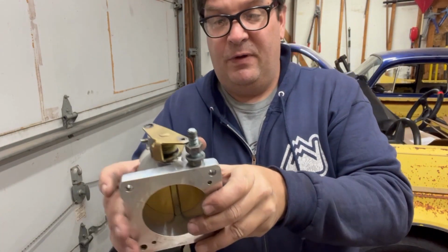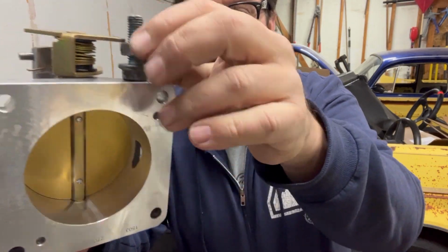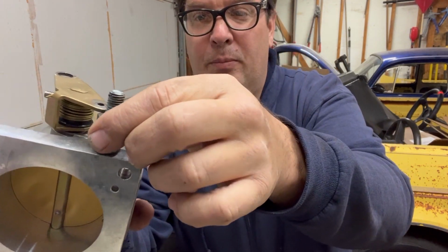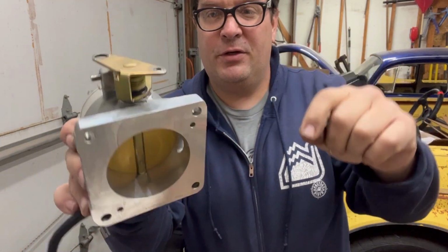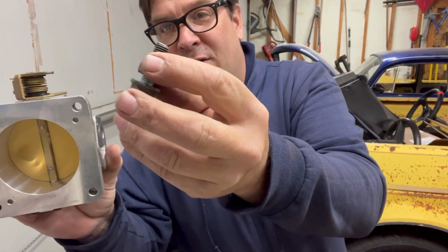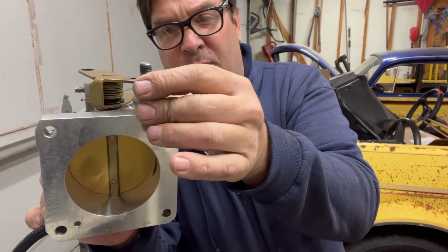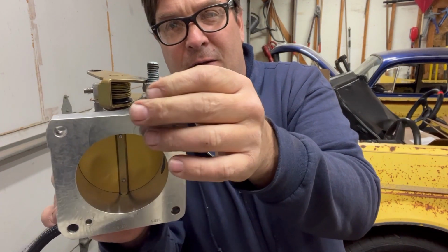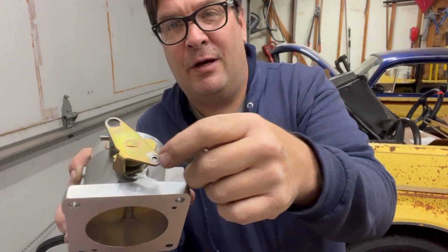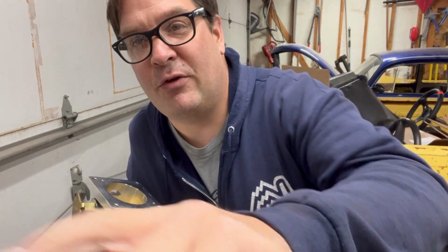Hey guys, if you ever need to knock a pin out of a hole like that and it's on an arm and you're worried about bending it, just take a nut and use it in there as a jack, okay? That'll help you out a bunch. Keep you from punching that out and bending it. It just takes a little bit of pressure. It's a pretty neat little hack. Just take a nut, run it in there, and twist it until it's tight, and that puts a little bit of pressure out at the tip, so when you go to pound that out of there, it doesn't bend your bracket for you. Anyways, that was all I was up to.